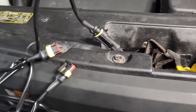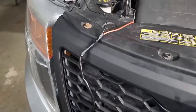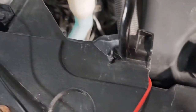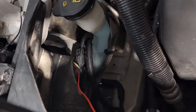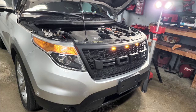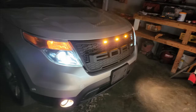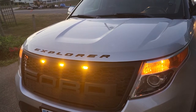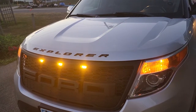For the LED lights, we're going to be connecting them to the always on lights, so that way when the lights turn on, they're always on. In this case, it's going to be the yellow wire, and the negative we're going to be connecting to the frame. Check the lights work. If you want to see a video dedicated to this, I'll leave a link in the description.